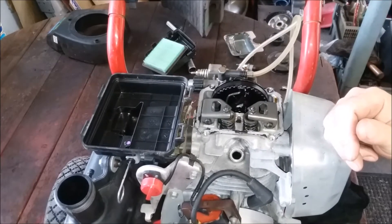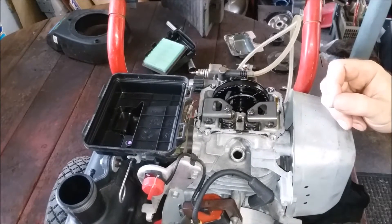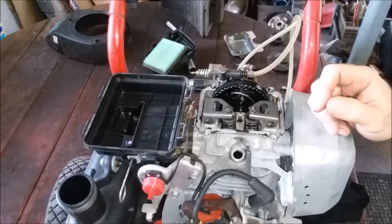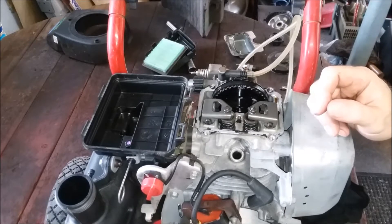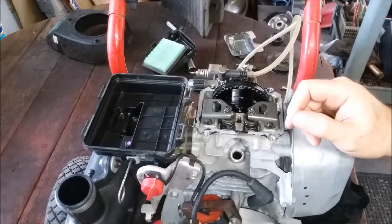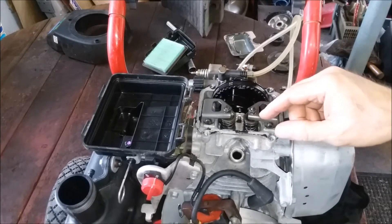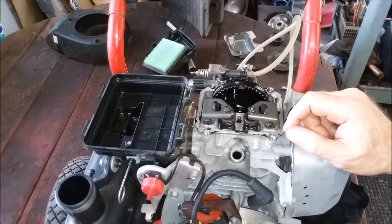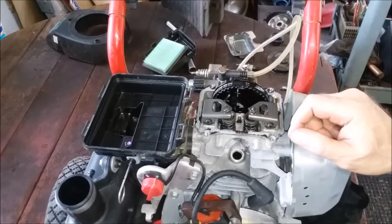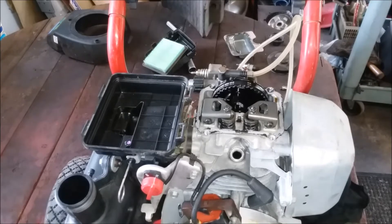I like to be somewhere around five thousandths and eight thousandths — this is intake, this is exhaust: five and eight. Let's go through the event: we should fire, and we're going to have an exhaust event here — comes the exhaust because it wants to get rid of the spent gases. And we're going to start sucking — fresh charge. We're going to come around for compression and then fire, and that's TDC. Here comes the magnets. There'll be a little compression bump where the exhaust valve will open a little bit just to release some of the compression. Right about here is TDC, so this is where we can check it.